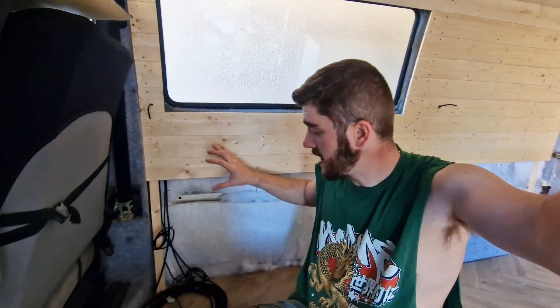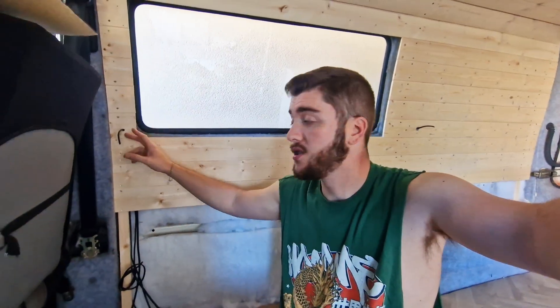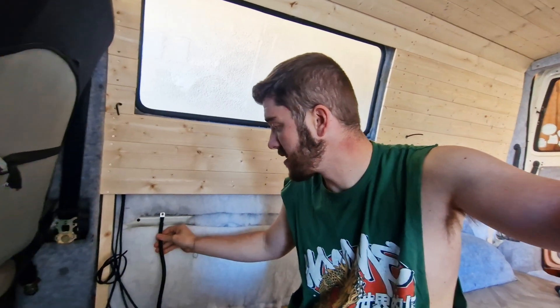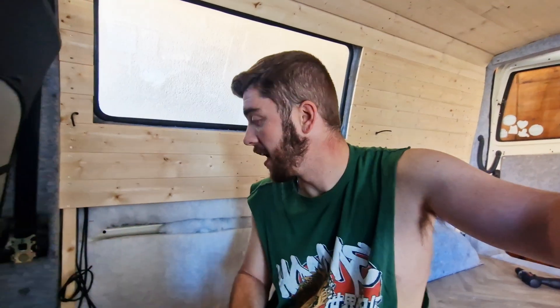The electrics are going to be terminated in this area. I've got all the electrical connections running down to this area — two USB ports, three lights in the ceiling, as well as the solar coming down off the roof. So I need the earthing connection to be as close to here as possible. There's a beam here which is absolutely fine for the earthing connection. What I'm going to do is take a wire brush, file back the paint so it's down to bare metal for a really strong connection, and then attach the end of this 35mm pre-made battery cable from 12 Volt Planet straight to the van itself. It'll then come through the wall and attach to our negative bus bar when the electrical system goes in place. We've got to do all these preparation steps to make sure everything's done correctly and safely.